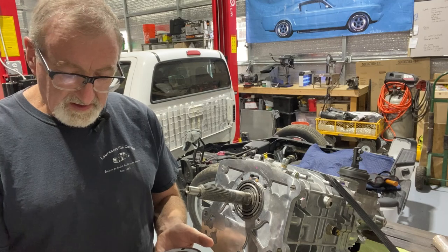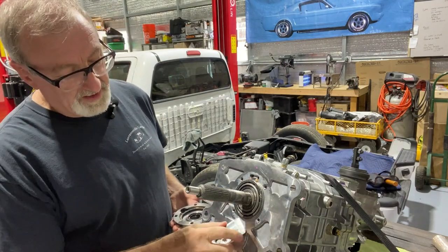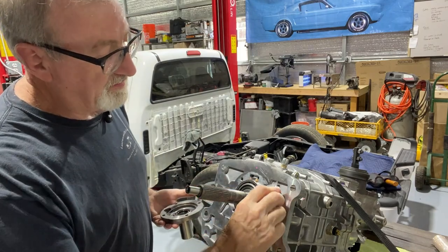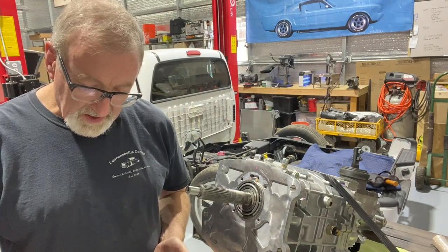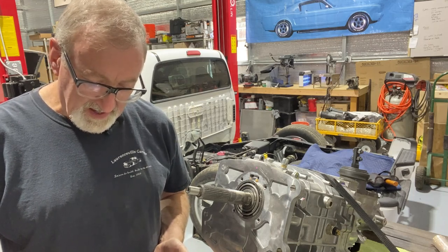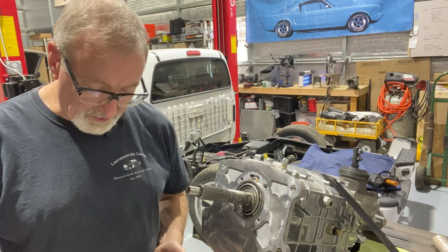They already have some petroleum jelly on them so they're kind of sticking together, and that's good. I've already cleaned this surface with a razor blade to make sure there was no goop or any foreign substance — any silicone — on here. Position the new bearing retainer without sealer so that the locating stud is at the top in the 12 o'clock position and attach it to the transmission using four socket head cap screws.